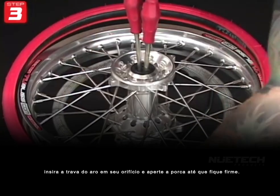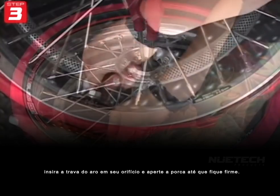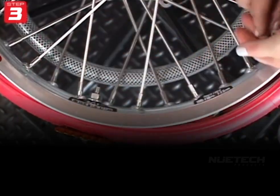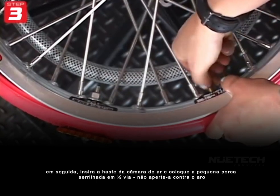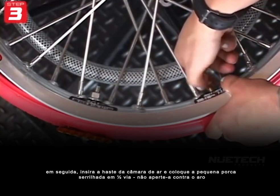Insert the rim lock into its hole and tighten the nut until it's snug. You'll want to insert the bladder stem and put the small knurl nut on only halfway. Do not tighten it against the rim.